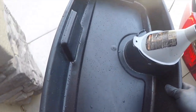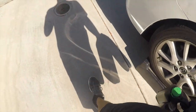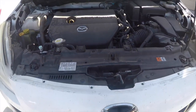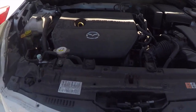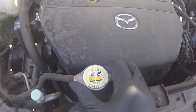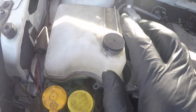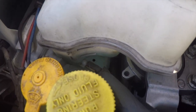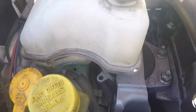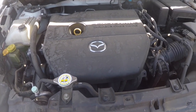When doing this, make sure your engine is cold — don't do this when the engine is hot or you'll burn your hand. This is the Mazda 5 engine bay. This is the radiator fill cap — this is where you'll fill the majority of the coolant after draining. After that, close it back up and use the reservoir instead. It has a full and low line, and there's also a bleeding procedure to get all the bubbles out of the system.